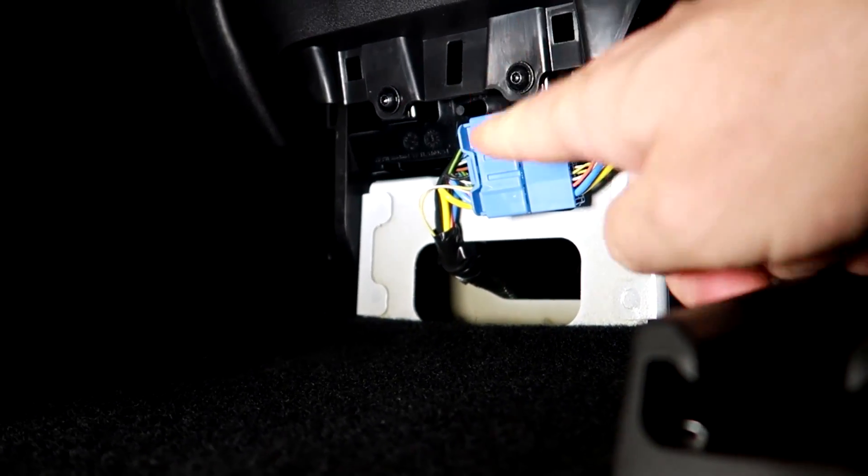Step two: disconnect this connection. Be very careful — don't disconnect it yet. We need to disconnect it but we need to power down the car first. This is a live connection. This is how the car's computer communicates with all the sensors and other components, and you don't want to interrupt it while the computer is running. This is like removing components from your computer while it's running — it will not end well. You may brick the car and it won't start up anymore.